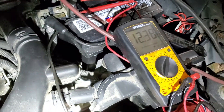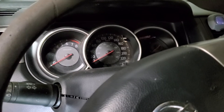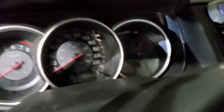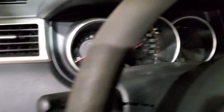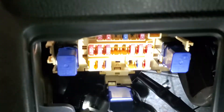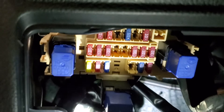I'm going to take this out — see how it's rapidly dropping down. Looking at the wiring diagram, I found out there's a fuse — fuse number three — under the fuse box right here. Fuse number three seems to be missing.